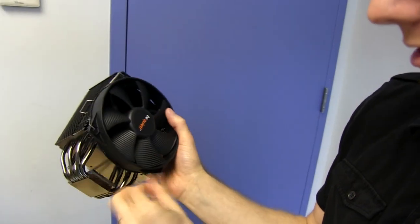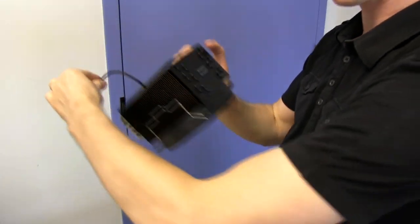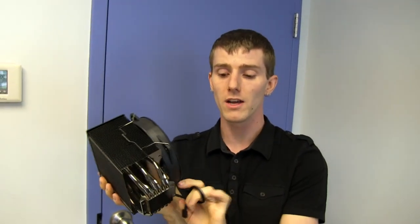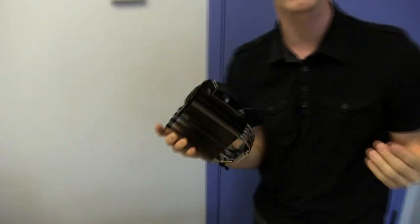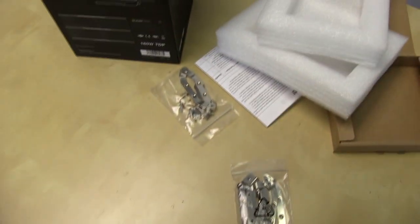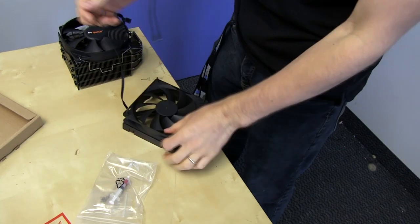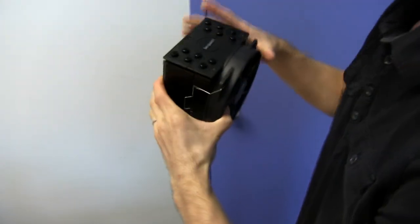Very shiny heat pipes. Little attention to detail: the fan has a short connector. Why isn't everybody doing this? The CPU fan header is never further away from the CPU than this kind of radius, so it makes a lot of sense. If it's a little bit closer it looks a lot cleaner — you give it a little loop and just plug it in really close. If you have a longer connector on the fan it ends up looking kind of cheesy. For comparison, this other CPU fan comes with a bracket to attach to the cooler, and even if you try the same trick it still looks kind of stupid because the cable is huge. Whereas with a nice short cable it can look really, really clean.